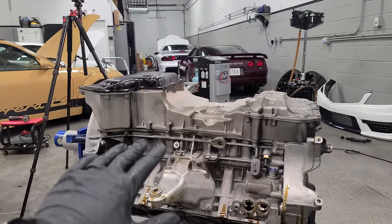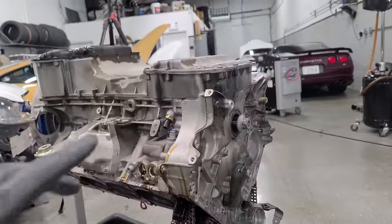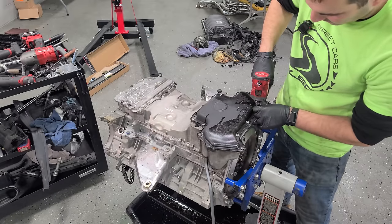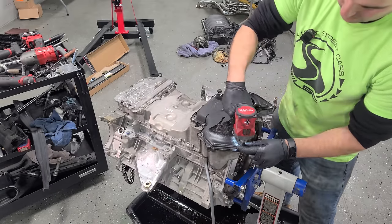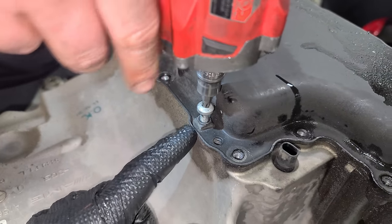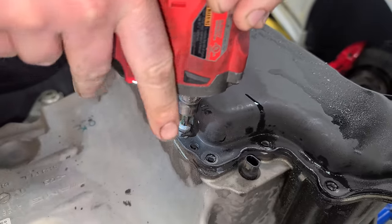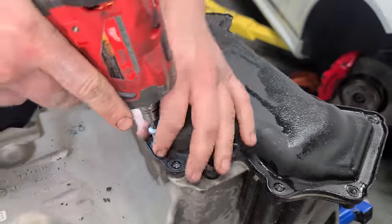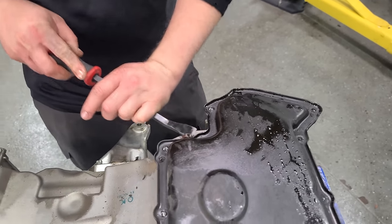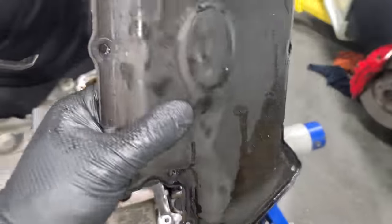This is a complete nightmare in the car. Most people just take the entire engine out anyway to reseal that half. But we need to take that off primarily to get the front cover off to get to these timing chain guides. The pans are RTV'd in. This one is held in by a few T30s. Once you get them all out, they give you this section of the oil pan that helps you lift up and break the seal, so you don't have to go crazy bending the pan.